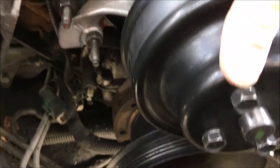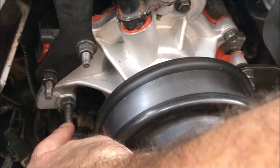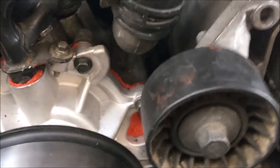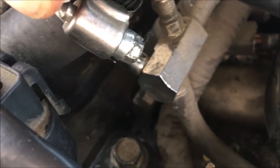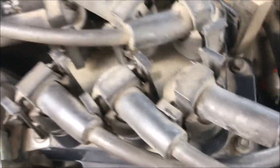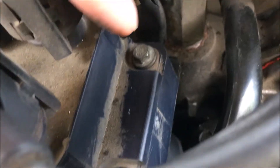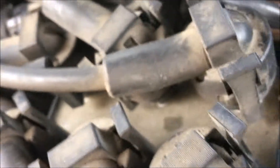Then you've got to remove the coil pack by these two nuts to gain access right here — one and two. Take those nuts off, then you can remove the rest of the water pump bolts. There's also another bolt behind this tube right here; take off the tube to access that bolt, which holds this coil pack bracket on. Or you pull off all these little coil bolts, and that'll help you gain access to that final 13 millimeter bolt.